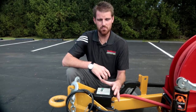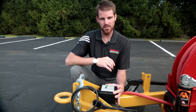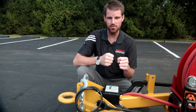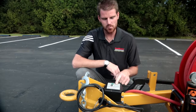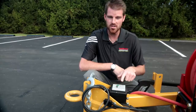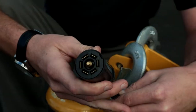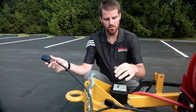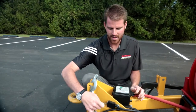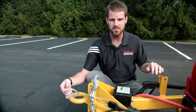This unit features our safety breakaway system. In the event that this trailer separates from the lead vehicle, you have a battery powered and battery charged braking system that will engage the trailer brakes and prevent it from jumping to another lane, hopefully bringing the unit to a complete stop. The breakaway actuator box has a push-to-test function with a green indicator light. You always want to make sure you're testing this as you're hooking up to your lead vehicle. We have a standard seven pin connection, and when plugged in we are charging the battery from the lead vehicle to actuate your safety brakes. We also have the cable which needs to be attached to your lead vehicle — upon separation, this will pull and engage the switch to engage your safety brakes.